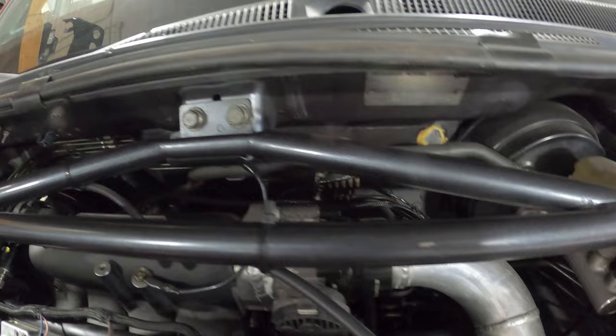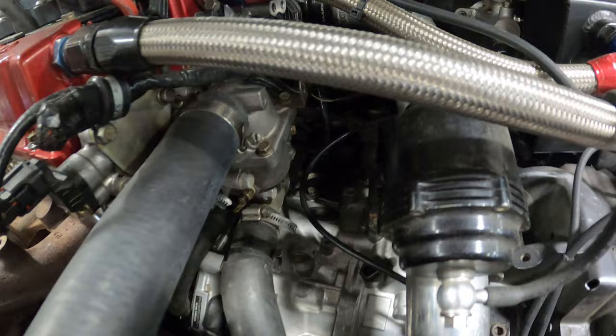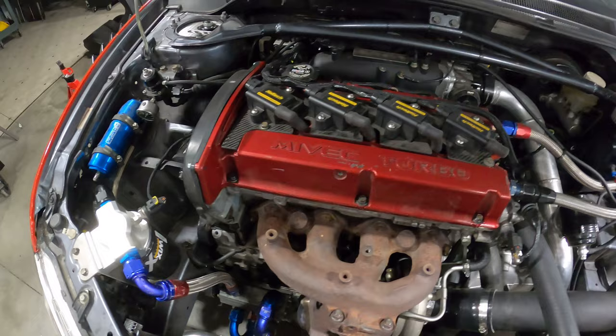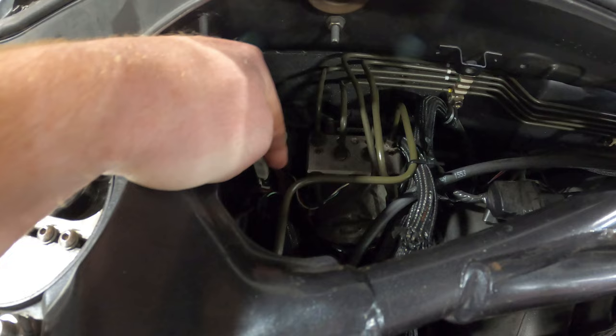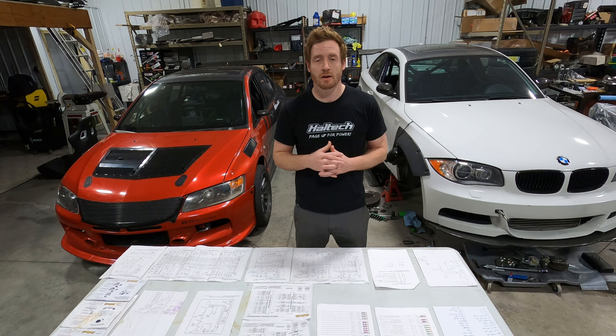The wiring also comes over to the oil pump, oil pressure, and oil temp. The second part of the harness goes to the right, underneath the throttle body, feeding the throttle body, both cam sensors, vehicle speed sensor on the transmission, coolant temp sensor on the back of the housing, IAT sensor, and the boost control solenoid on the right. One thing I don't want to leave out is grounds — make sure you have plenty running from the engine to the frame. We have one on the passenger side, one on the intake manifold, and one on the transmission. The ABS unit is also located right here, where its harness connects to the wheel speed sensors and other sensors.